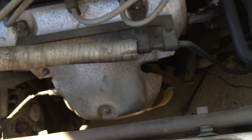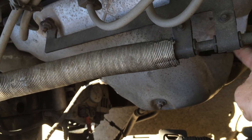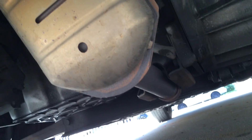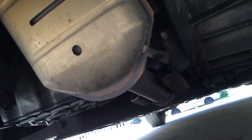In my case, that's the problem. There's also a junction underneath the heat shield between the catalytic converter and the exhaust manifold that could be leaking. And then under the car as it goes back to the muffler, you'll want to jack it up and get under there and look for any holes where it might be leaking.